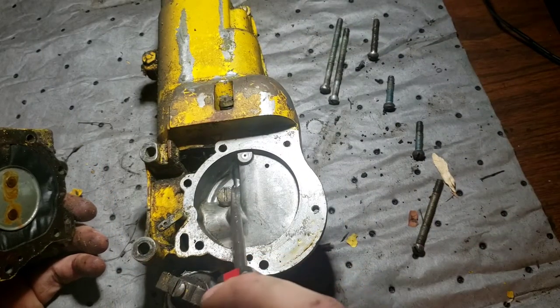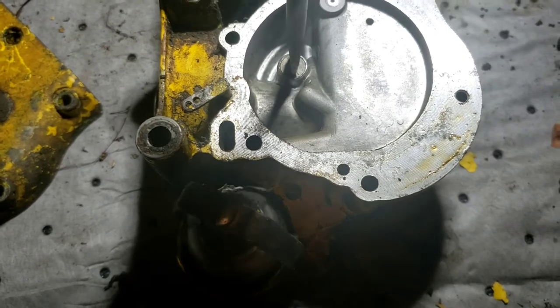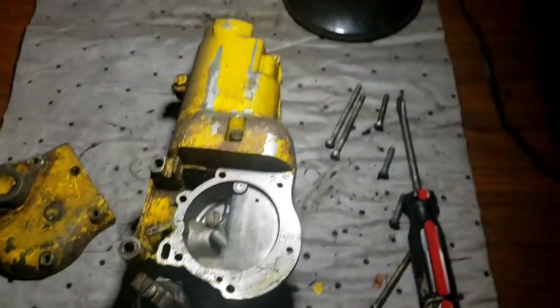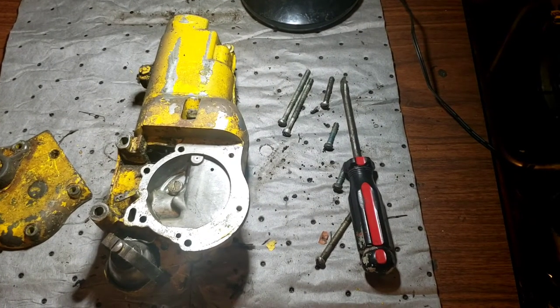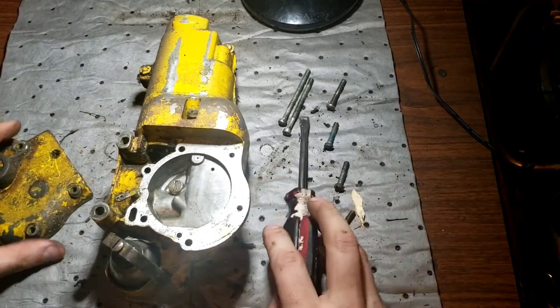There's another screw right there. Yeah, somebody's been in here. You can see the witness marks, the tooling right there, where somebody fought to get that off. So this carb has been rebuilt before. So it tells me this saw was used quite a bit. It kind of points to maybe the tank was put onto it. Somebody slapped it on there because the flywheel shroud on it is missing most of its paint, but the tank is an oddball and clean and yellow. So it probably had a tank swap done to it because somebody broke one, and that's just my theory, but somebody's been in here before.